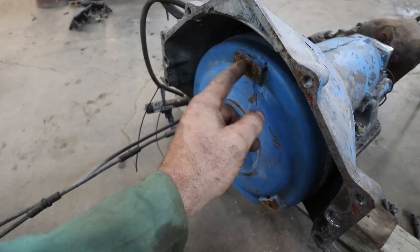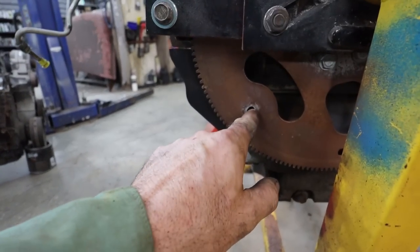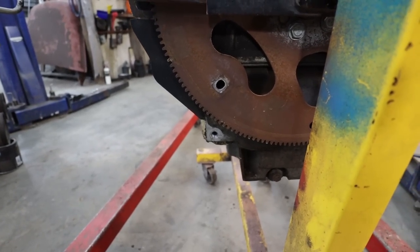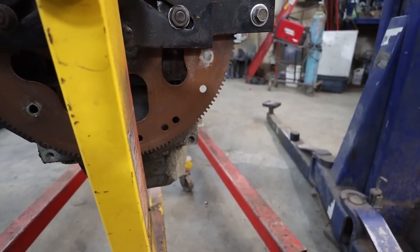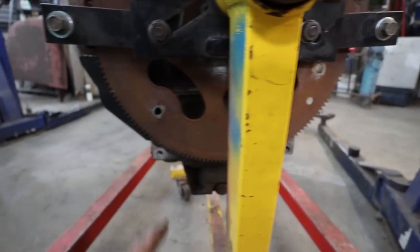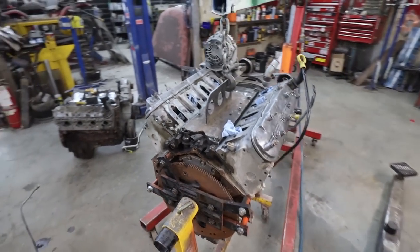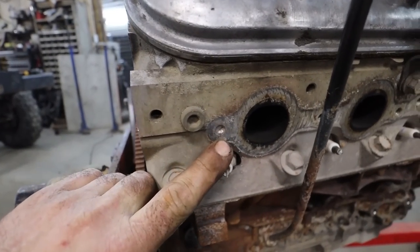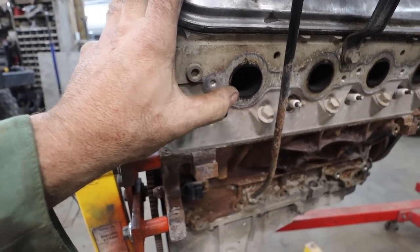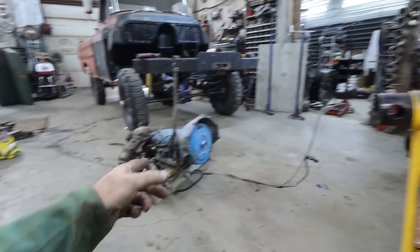The only thing here is these torque converter bolts, they don't line up. So a feller has to actually slot these holes a little bit. We can do it here, we'll just oblong this a bit. But anyways, we got to do that. I got to come in here and we got the typical one exhaust bolt broke. So we're going to do the old washer, weld, nut, pop that out really quick. Then we can bolt that together.